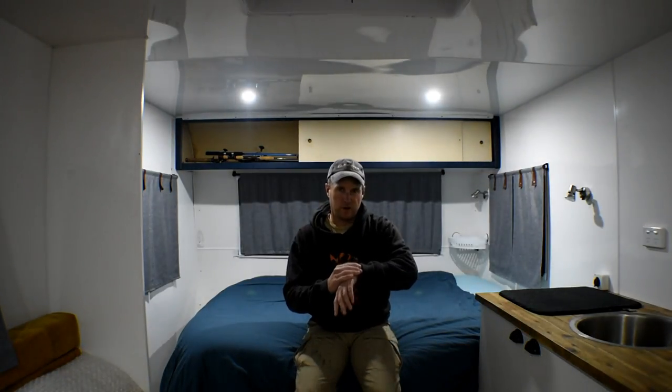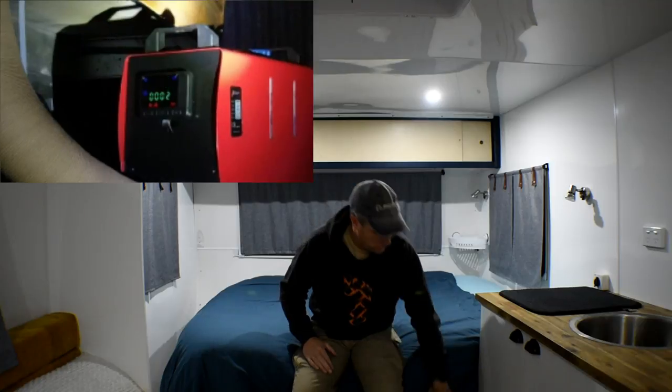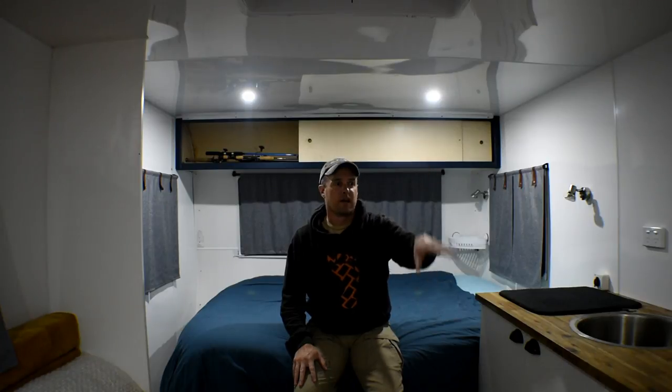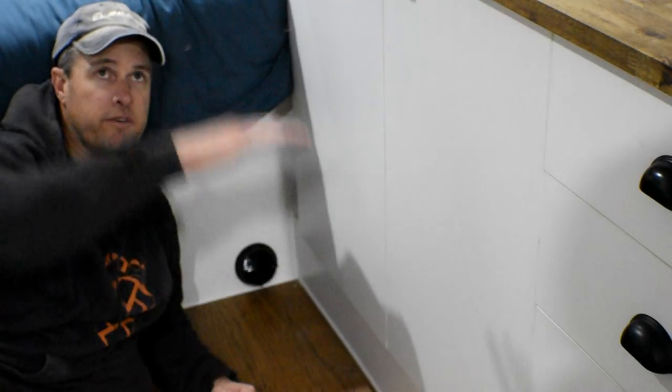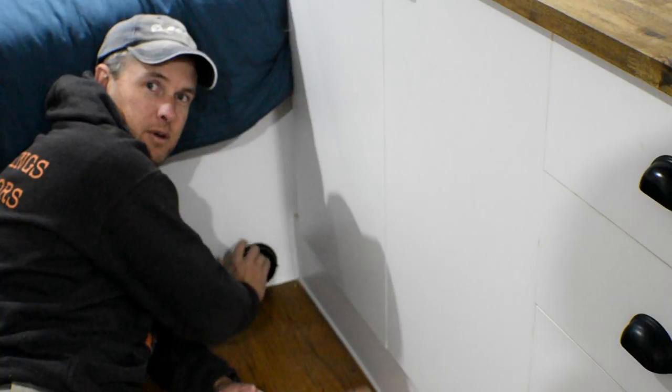It's nearly 7:30 at night and it's a brisk 10 degrees Celsius at the moment. I've just hooked up the diesel heater to the duct outside and turned it on — it's set to 22 degrees Celsius. I'm going to see how long it takes to heat up the caravan. I've got the temp sensor sitting about midway in the caravan, so it'll be interesting to see how quickly it warms the space up. I've placed the duct down and lined the caravan so the heat can convect right up through the height of the caravan. I can feel a nice bit of warm air coming through there already.